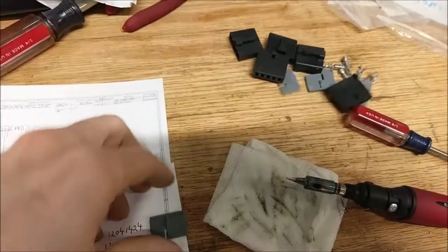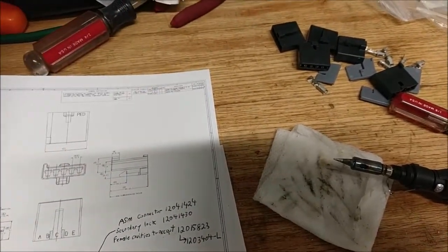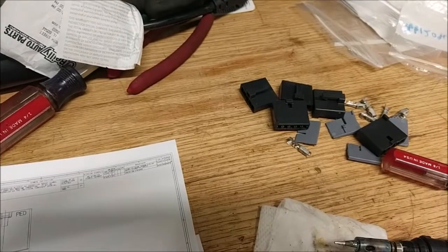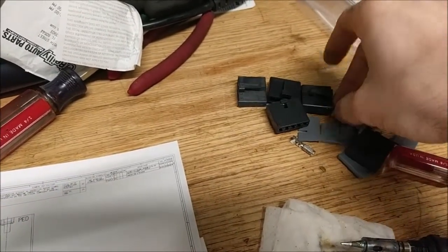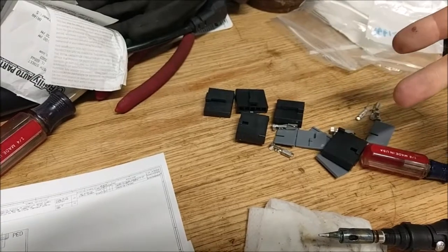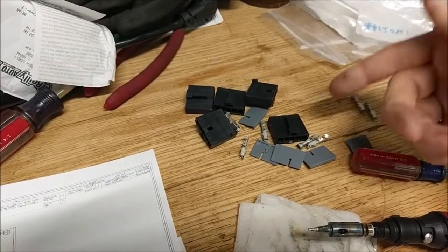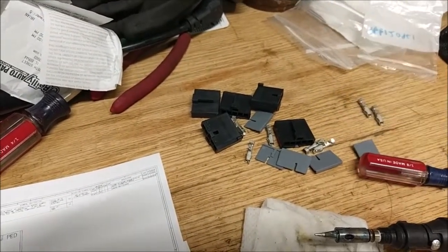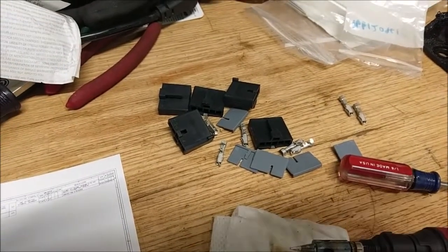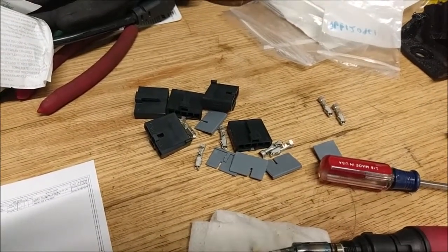This connector is going to keep overheating on you. The only way to really get around this problem is to drill a hole into the side of the module, solder a wire straight to it, run it around, tap it into the harness — tee it in and solder it onto the vehicle harness. That way the high-power current connections aren't actually being used in the connector; all you're doing is providing the signal wire through the connector. But I'm going to make it look more like factory, because I'd rather have some other mechanic trying to figure this out in the future, let him replace the connector instead of putting a true fix in — so you can just keep swapping out those hundred-dollar modules and they'll keep melting. Same thing with the connector — you can get these with a pigtail for about 18 bucks on the internet.